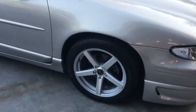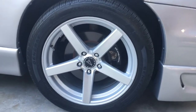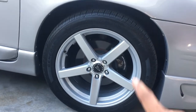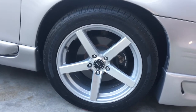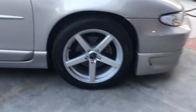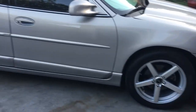I'm going to be painting the rotor hats black — I have some VHT caliper paint for that. I'll show you what the factory brakes look like on the Grand Prix. In order to run that kit, you need 17-inch or bigger wheels. I have the front General Motors performance part bracket, which is found on the police Impala package as well, and it allows me to run a bigger rotor — I believe it's a 12-inch — while keeping the factory single piston caliper. It just allows more rotor surface area.